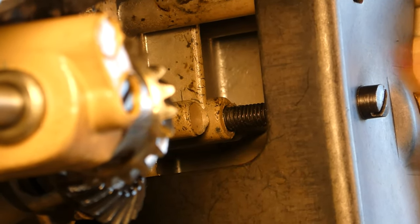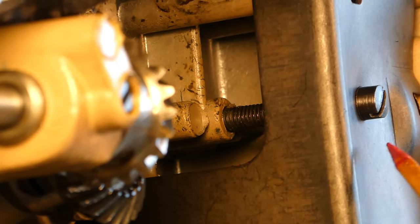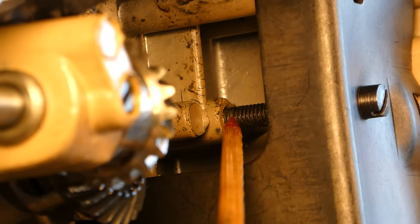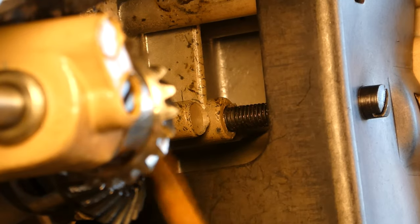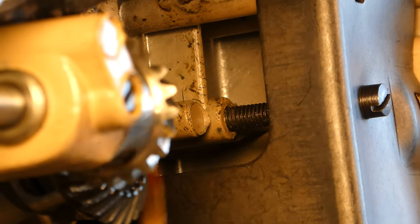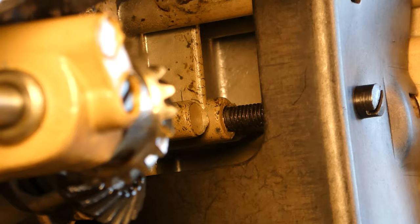Here's the mounting plate — the engine mounting bracket. If you look at it full-face frontal it's difficult to know whether the screw is going into the threaded hole or not. So what I did was, as I go to put it on, I look kind of sideways right there, and then I can see that it's actually seating. That way I won't end up tightening the screw without it being where it needs to be. Just passing along that little tip.